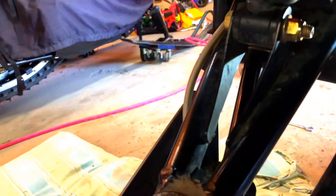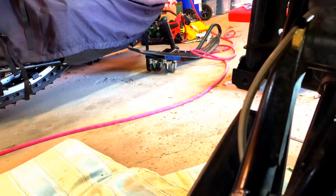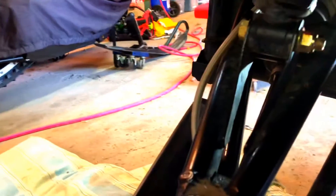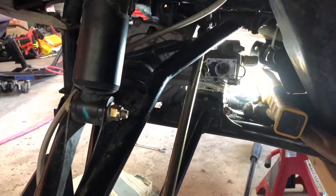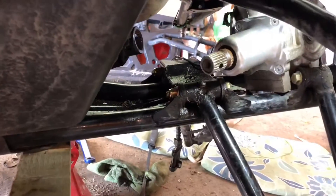I'm gonna pull the axles and pull the diff right out — I'm done messing around with this. I could screw around for three more hours or I can just pull the diff. Let's figure out the best way to do it on this machine — probably pop one or two of the ball joints out, maybe the top shock, get that out of the way, flip it down, pull the axle out. Anyway, we'll give it a go.